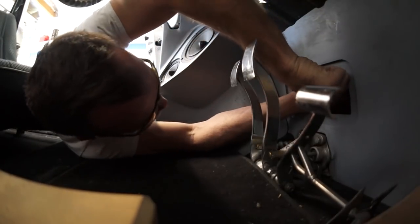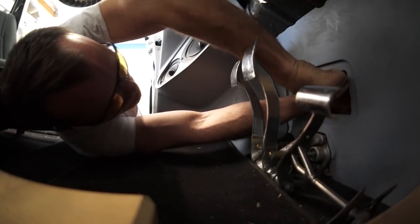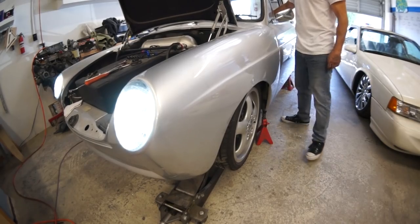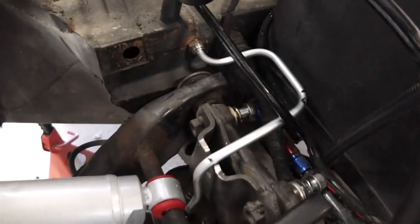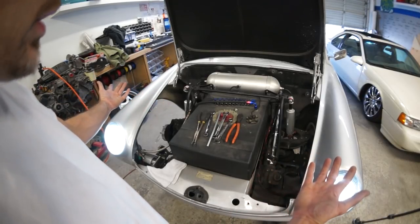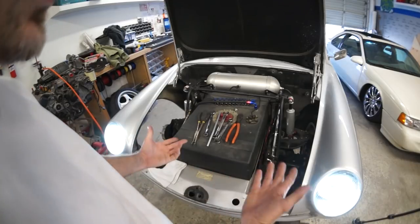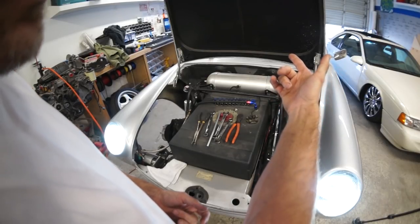There it is — in the bulkhead, through the frame, into the airbag fitting. I can access these airlines through the access panel I created. Switching these fittings around. That finally fixes the last air leak in that broken shock — we should have done that years ago. Now this is ready to drive and enjoy once we get the motor back in, and then the transmission, because the reverse gear remember.